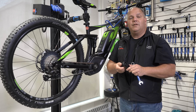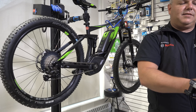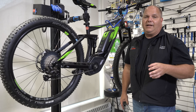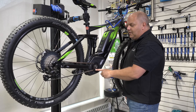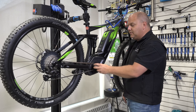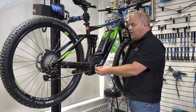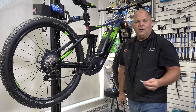Next I'm going to remove the extractor tool because we'll need that out when we put the crank arm back. The next step is this chain ring lock nut. There are different varieties — we have the traditional Bosch one, which is standard aluminum, but companies like Miranda have come out with their own unique locking ring and bash guard in one unit. They use exactly the same tool to take them off, just different concepts but they do exactly the same thing.